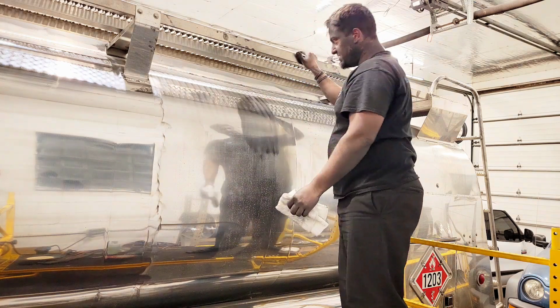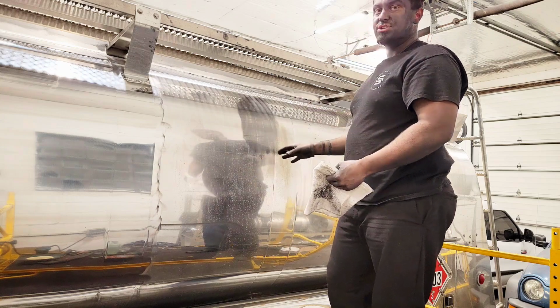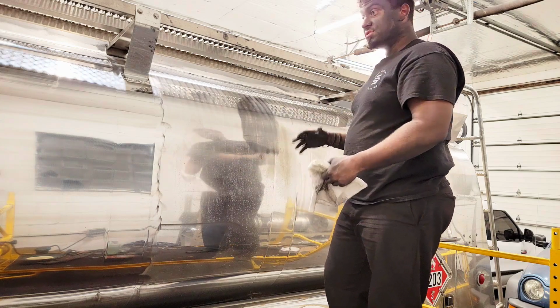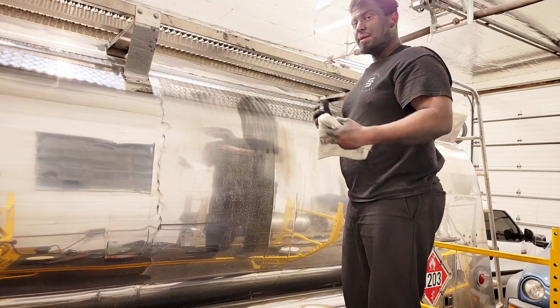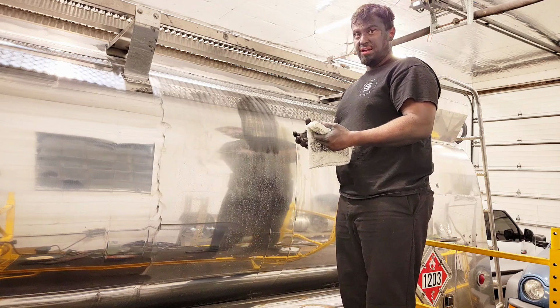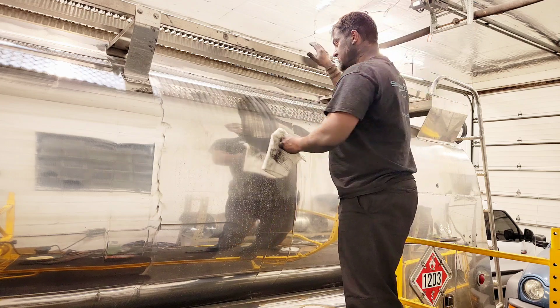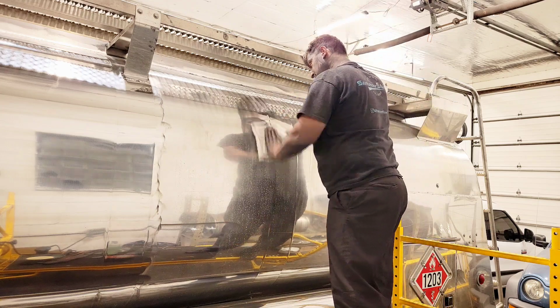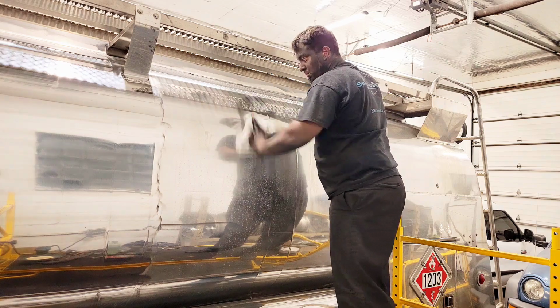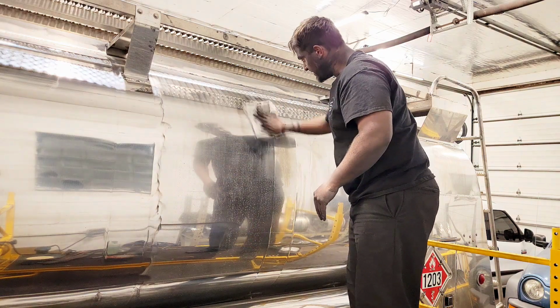You don't need to get it clean, just kind of do that until you have a little black haze, and then let that flash off. That'll reduce your time and reduce the struggle taking it back off. A lot of metal polishers will have really thick waxes in them and stuff like that, and can really be hard to get off. So you really want it to be a nice light finish when you're done, and then you're just gonna start rubbing, and you literally buff it off. So that's what you're looking to do here.